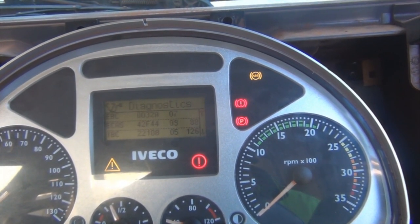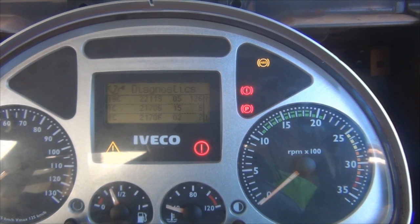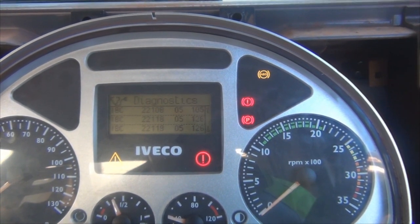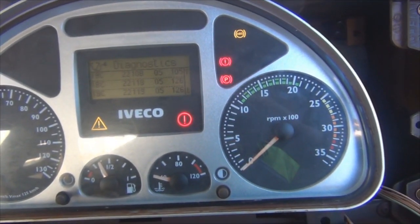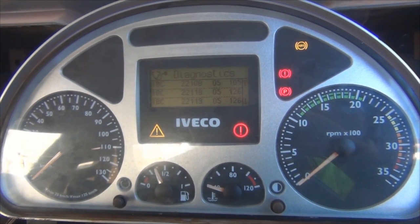She's really not happy. Just about every code that exists is being thrown, and multiple times too. These trucks apparently have an issue where the insulation on the wiring was insufficient so it could rub through, and I do believe that's occurred in a couple of spots.